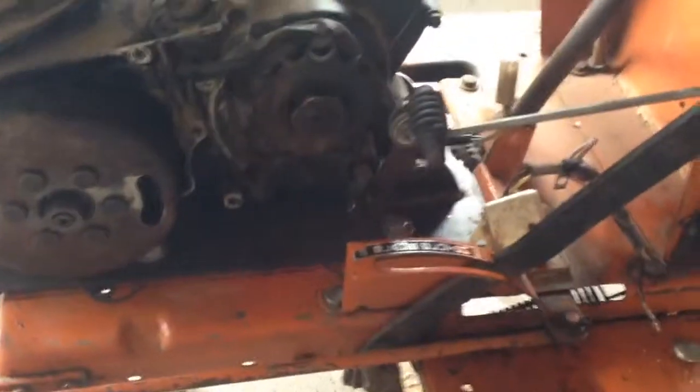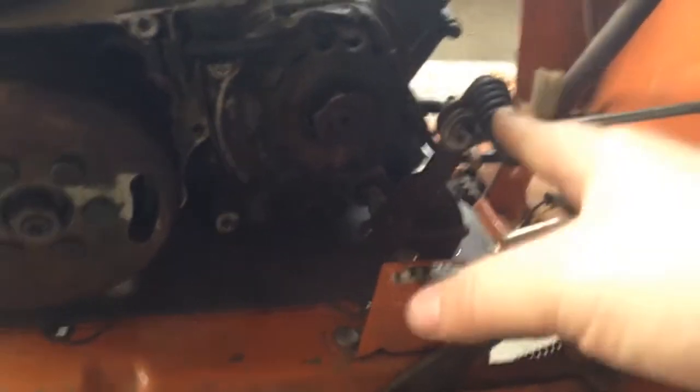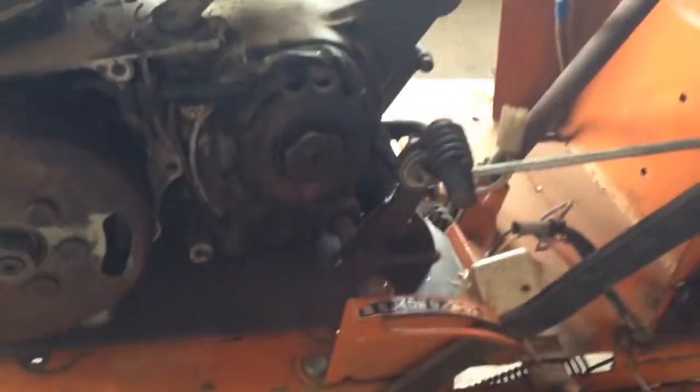shifting. I did this. It's very, very simple. Welded up a bracket, got a piece of hickory wood, carved it in there so it would fit the plate at an angle. My brother made a bullet shifter. It's a hunk of aluminum he machined in welding class. Just a simple linkage between there. These are on splines, so I pulled it off, stood it straight up, drilled a hole through it, and that's the shifting. It's very simple. Don't have to worry about it.